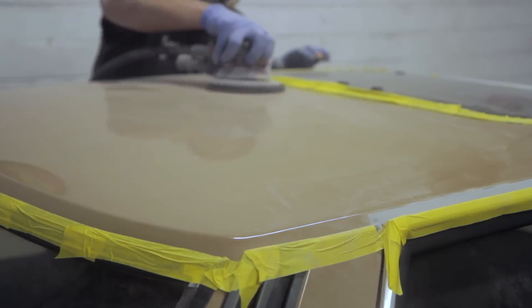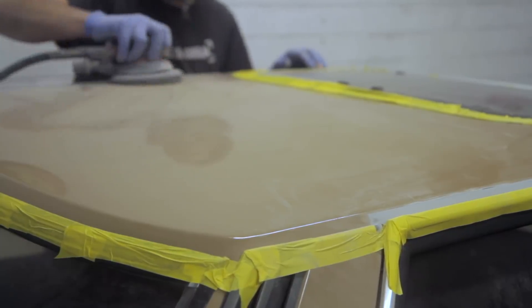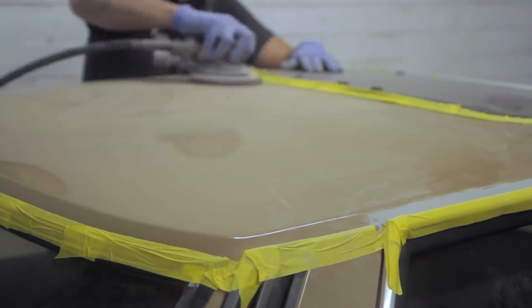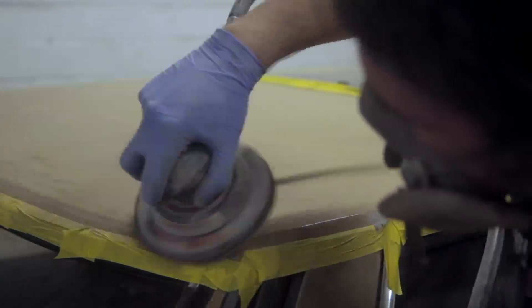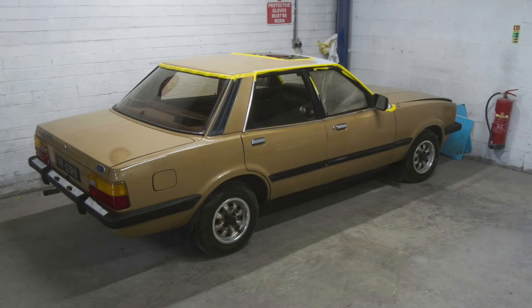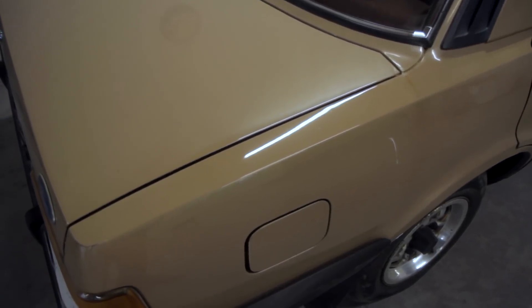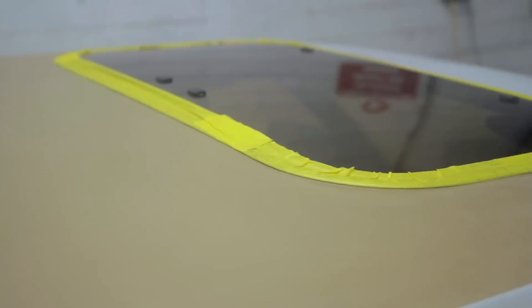We're being very careful not to lean on it in any one place too much and to progressively sand the panel evenly. As Gar said, you could spray over 320, but to do a nice job 500 is the way to go. So I went around the whole work area again with 500, but as I did and came back across the grill and middle section of scuttle, I exposed bare metal and my heart sank — I thought I'd destroyed days of work. But to my relief the guys said if you don't expose metal at this stage you probably haven't sanded enough, and they assured me it will be fine.